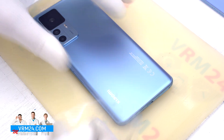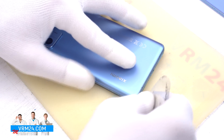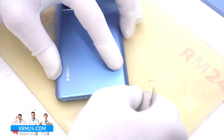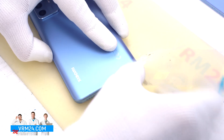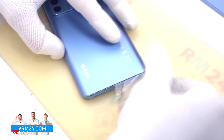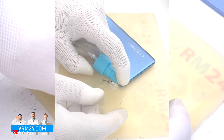To detach the back cover we will use a plastic film — this is the protective film from a new display. We insert it into the gap between the middle cover and the back cover, choose a corner where we can slip the film under the back cover, push it through and run it lengthwise.